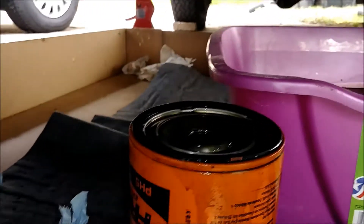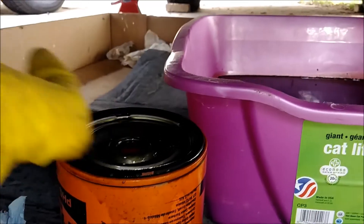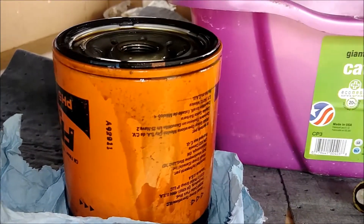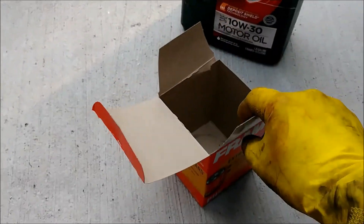This is still draining, so I'm going to get all that junk wiped off with some brake clean sprayed on there, wipe it down, get the plug put back in, take the new filter, put some oil around the rubber o-ring to seal it up, put the new filter on, put the drain plug in, then we'll get it filled up with oil. Fifteen minutes into this oil change, maybe twenty. New filter's on, oil is open.